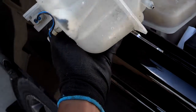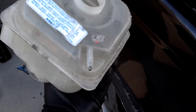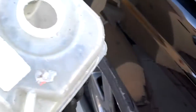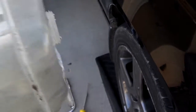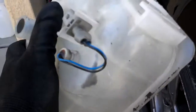Here's the clear coolant reservoir that I found in the junkyard. It doesn't look maybe a year or two old compared to my yellow one that I can't hardly see through. The big thing with replacing these 850 coolant reservoir tanks is you want to make sure that you can hear the float going up or down, because that is what triggers your low coolant light in your system.